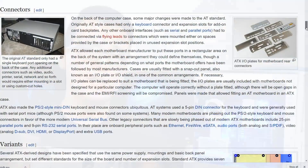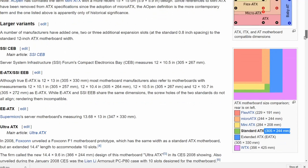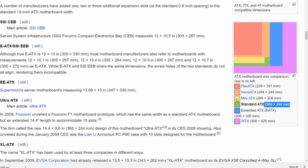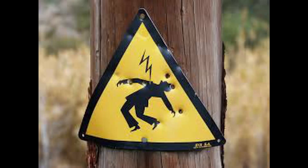I'll link the ones I bought below if you decide to build a system like this yourself. The next issue, which I mentioned in part one, is that the case is actually built for standard ATX motherboards. Server boards tend to have varying sizes, and this one in particular is extended ATX, which is just a few centimeters longer than standard ATX. Fortunately, it was possible to simply remove some components in the case and drill my own motherboard standoffs to expand the available space. I also used hot glue and electrical tape where necessary to avoid any metal touching the motherboard, which ultimately would cause a short.